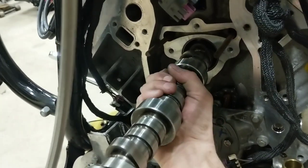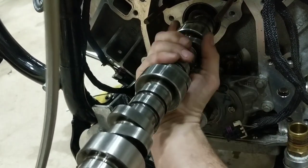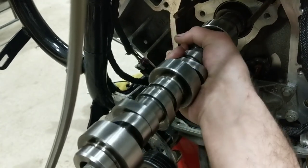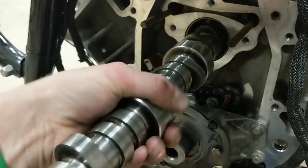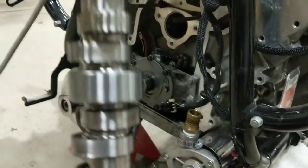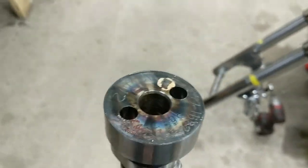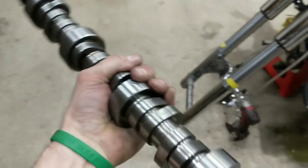Okay, so now I do have the camshaft out — I kind of needed a second set of hands there, so I had to put the camera down for a minute. There's the cam out. We ran the numbers on the back that are ground into it and everything looks really good. Fortunately on this bike, it's pretty easy to access everything — there's not really much below it except a skid plate and a lift point. We have the seat and side panel off here to actually remove the computer, which is up under where the seat mounts — so we can install the new computer. But you don't even have to touch anything on the side of the bike to do any of the engine work.